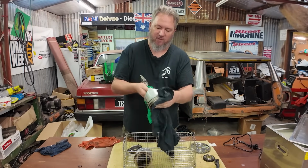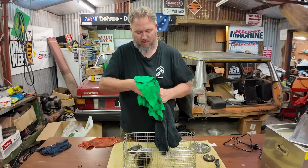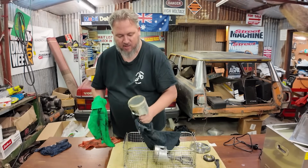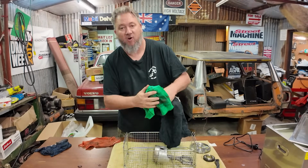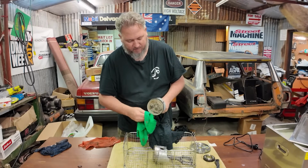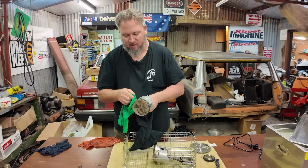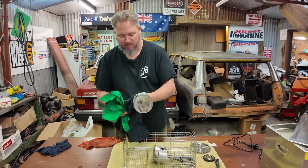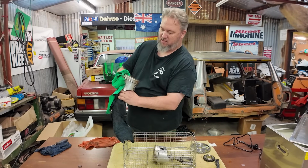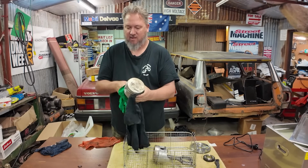So just be aware that parts will be warm, quite warm, especially at 65 degrees where we have it now. But yeah. So look, this one, again, the carbon's actually wiping away. Could probably pull the rings off and let the ring gaps get the benefit of a full cleanse. But yeah, the piston is quite a bit cleaner than it was. It's not spotless, not yet, but I think if I put that in again, she would clean right up.